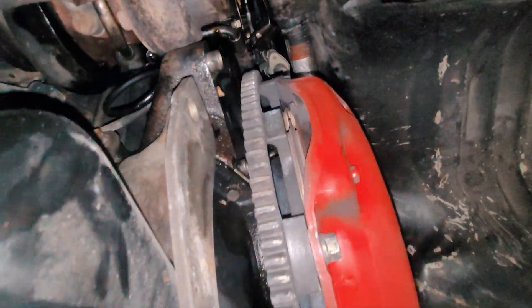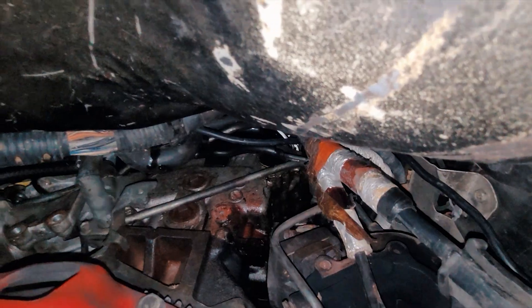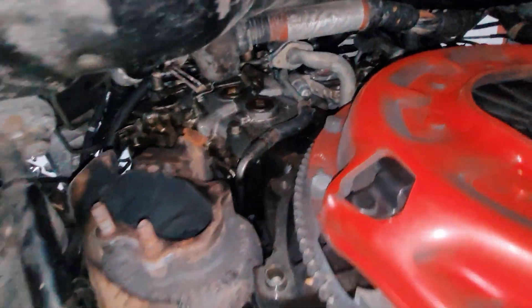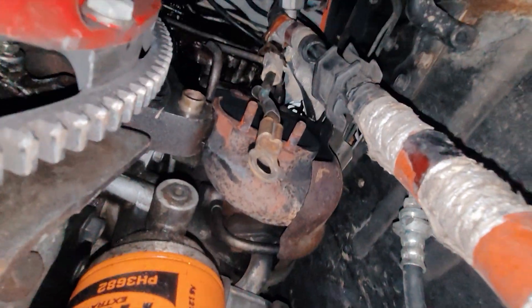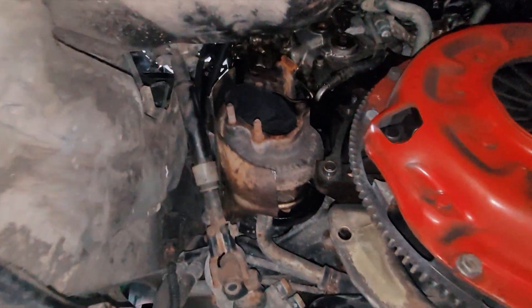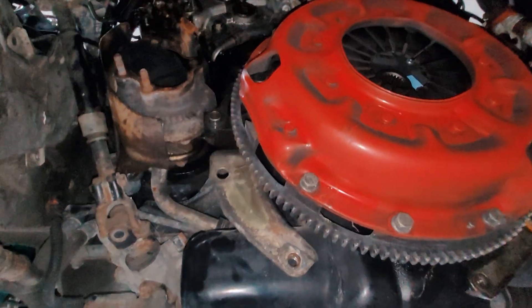Something is leaking. There are valve cover issues causing the whole thing. The turbos are leaking — it's starting to leak right there. So you know what that means: this turbo is going to come out, and they don't come out to be fixed — they'll be replaced.